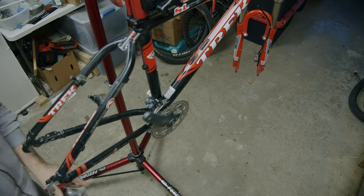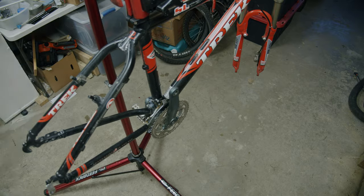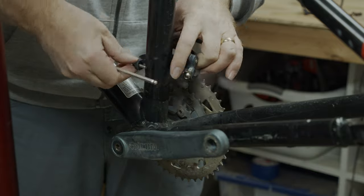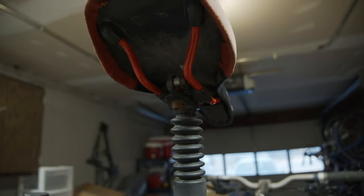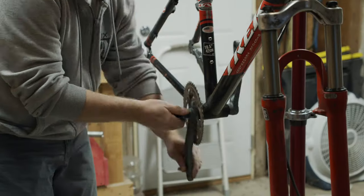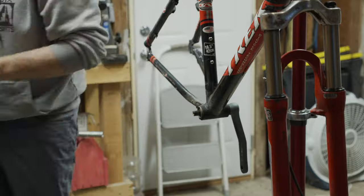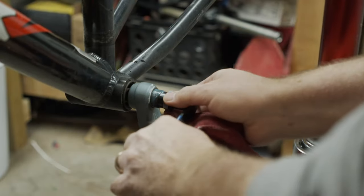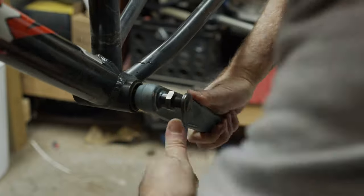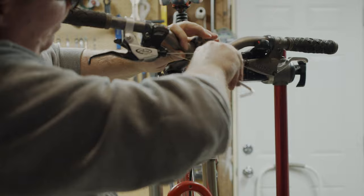A common misconception is that higher-end mountain bikes tended to have all stainless steel bolts, and that everything else that was aluminum couldn't corrode. But as you see, even on a higher-end seat post, if they decided to go cheap with the bolts, you could have rust on galvanized parts. Even a higher-end Shimano bottom bracket has steel sleeves that can rust over time. So it's important whenever you work on an older bike like this to look for parts that are corroded and replace them.